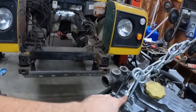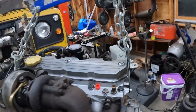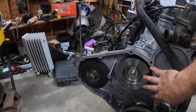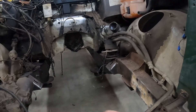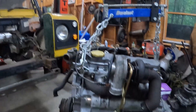Nicely enough, the Defender engine has built-in front and rear brackets, which makes it seem like they were absolutely prepared to have you remove the engine a bunch of times. It makes life easier for me. I didn't do the timing yet because I can do that at a good working height with something to torque against, so I don't risk knocking the engine over.